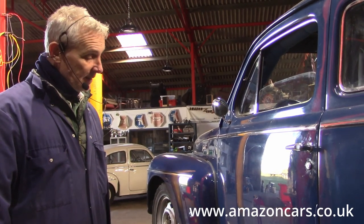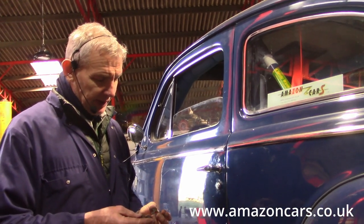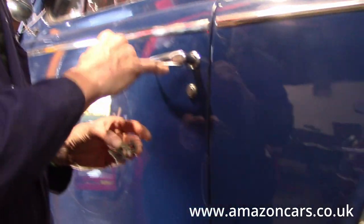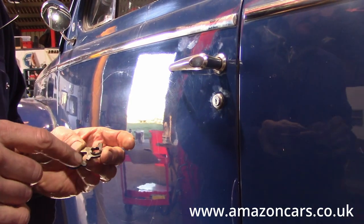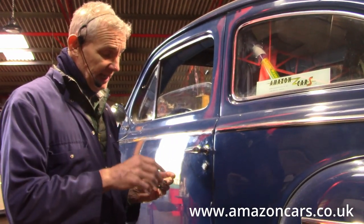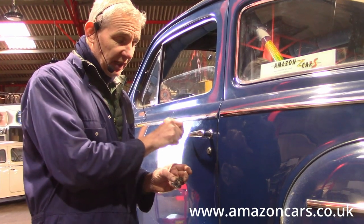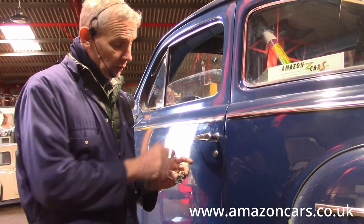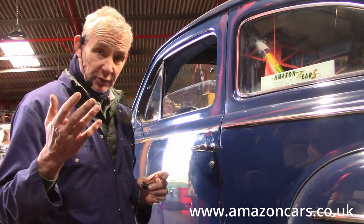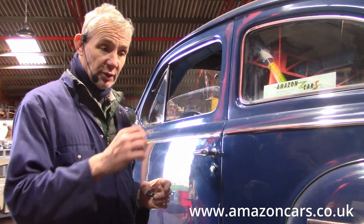The important thing is that on your vehicle it's possible that wee boss is a bit of an interference fit, in which case you relieve the plate to accept it cleanly. On probably 50% of cars it's a clean fit and you don't have to touch anything, but on 50% of the fittings we've found we just need to ever so slightly file away that hole for the boss to fit - very, very slightly, less than 0.1 of a mil. I'd rather create these latches slightly tight so you've got a good fit in 90% of cases, and in 10% of cases you do a bit of relief and have a perfect fit.